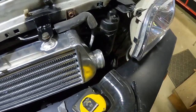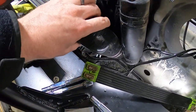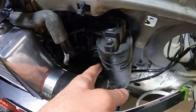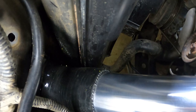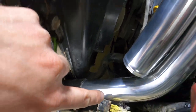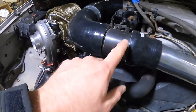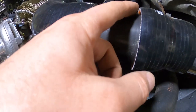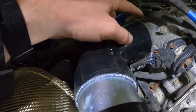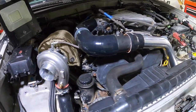The outlet side is a little more of a challenge — not much room with the AC component there. I got a two-inch 90 going down; I took the bottom bolt out and kicked it over a bit. It steps up from two-inch to two-and-a-half-inch, which is the intercooler piping kit I have. I'll cut here and put a joiner, then it comes up to the mass airflow sensor housing — I cut that out of the air box, trimmed it back, and fit it over a two-and-a-half to three-inch reducer. Then it goes three-inch around and two-and-three-quarters into the throttle body.